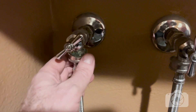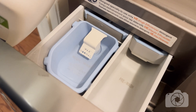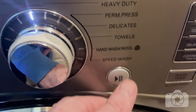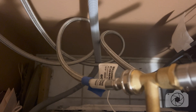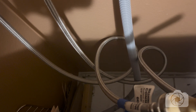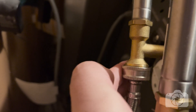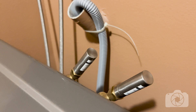Once the hoses are back on, I can turn the water faucet valves back on. Once those are on, we have water pressure in the hoses, so I can look for leaks and feel around the connections to make sure no water is dripping. I already have a load of laundry in the machine so I don't waste water doing a test load — I'll put some soap in and turn it on. Right away you'll notice there's no knocking sound in the pipes when the washer abruptly turns the valves on and off to fill the wash load. If nothing is leaking, I can push the machine back to the wall and hopefully enjoy great washing and no knocking pipes for years to come. Thanks for watching.